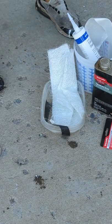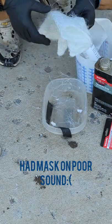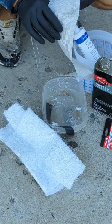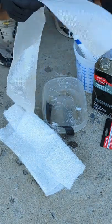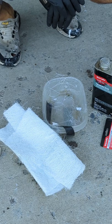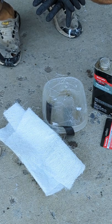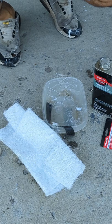I'm going to use two fiberglasses for this repair, as you can see. I'm going to use the mat, which gives it the ultimate strength. And I'm going to use the cloth for the final edges, the final details. And shout out to Boatworks Today. I did a lot of research on fiberglass repairs, and I have gotten a lot of inspiration from his ideas.